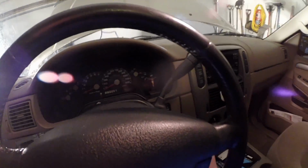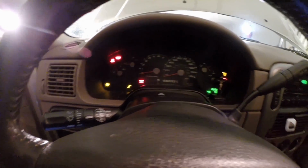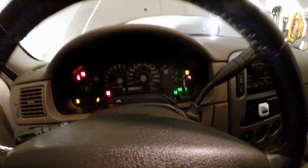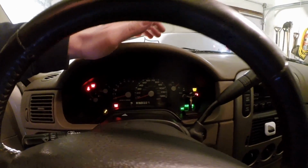We go over to here, having some IDS issues. You turn the key, and everything powers up just fine, okay? There's no flickering and flipping out from the PCM, okay? And we still have a theft issue, but what I think is happening is because it went to such low voltage like that, and the battery's actually shorting internally, that it actually is erasing the keys each time.